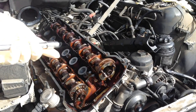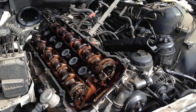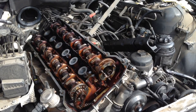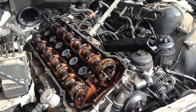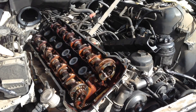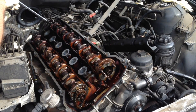You're going to come in here with the E12 inverted torx and you're going to check the head bolts. These aluminum block motors have a lot of problems with pulling the head bolts. We're going to go through and check them — what we're looking for is anything that's loose. If any of the head bolts are loose at all, it's not just loose, it's stripped out.